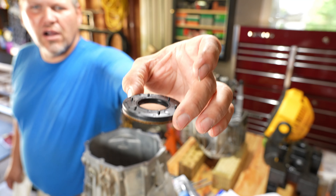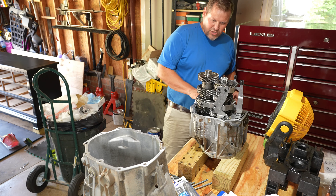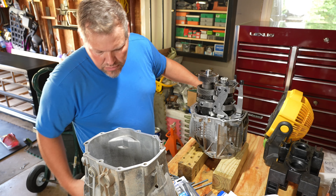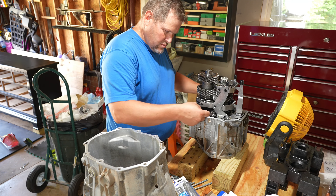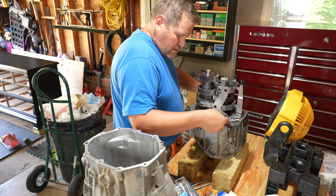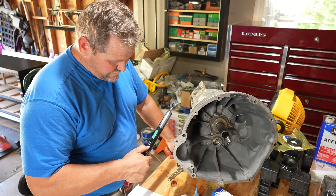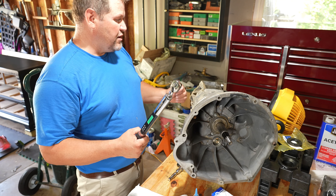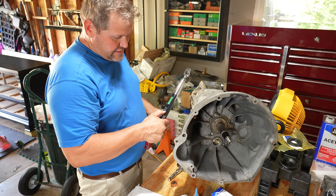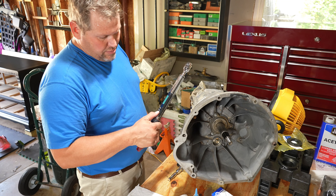There's that rascal of a seal — Harley went up and picked it up. After we get this bolted together I'll spin it around. I got these two case halves put together — I literally had the bottom one set up here, slid the top case half down, gave it a couple taps with a mallet and it's together.